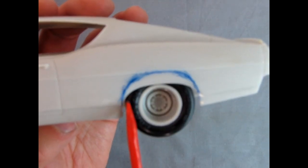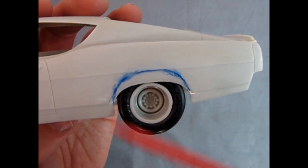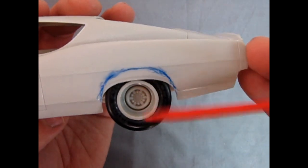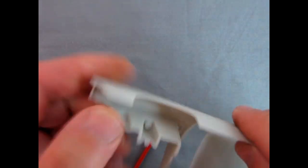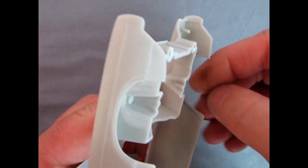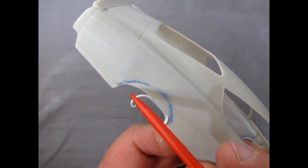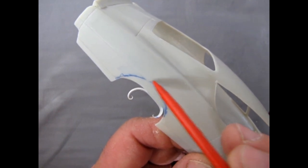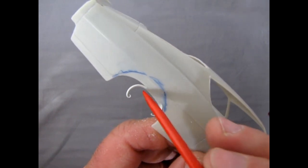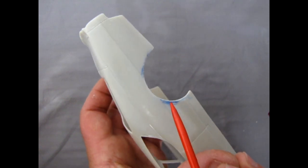Once you remove the other tire after drawing your Sharpie line, you should have something like this. This area here is perfect for removing — looks like it would fit the tire quite well and would allow for the car to bounce up and down inside the wheel arch. Here's what I got for the rear ones — now I'll go and cut those out, and for the front I'll just follow the inner line around and open up the fronts. When opening up these wheel radiuses, carve in a little bit at a time and keep going until you get to the line — don't try to cut it all in one shot. Just little by little, like wood carving.